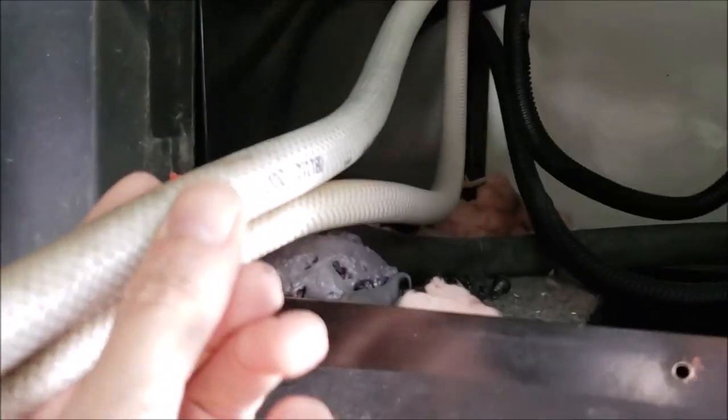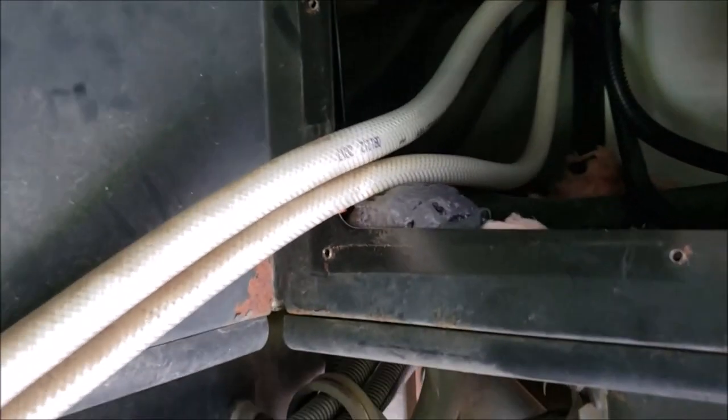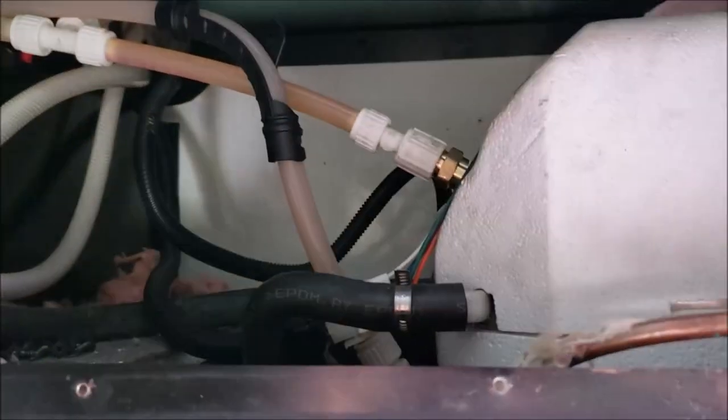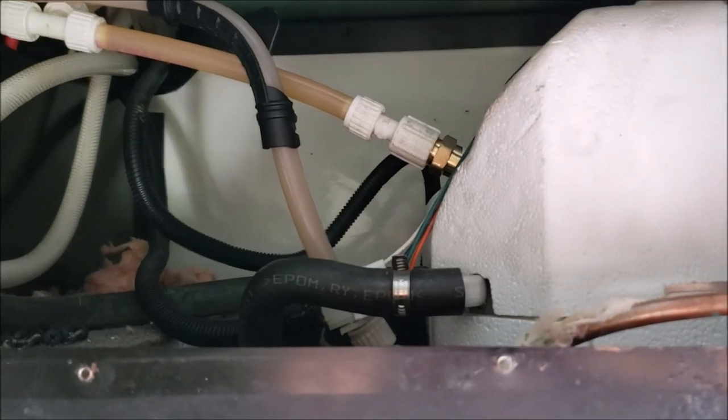You may be wondering about these crazy white hoses — yours won't have these. I added a dishwasher years ago as an add-on, and the tricky part is I put it into the slide mechanism — the dishwasher is right above us. I had to install low-point drains and run the hoses through this accordion-looking thing so they wouldn't kink up at the low-point drain. That's why you're seeing these weird hoses that you won't find in a standard RV. If you want to put a dishwasher in, you can — I'll make a separate video on that. All right, I guess this project is done. Have a great day and thanks for watching!